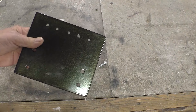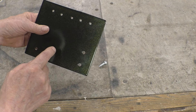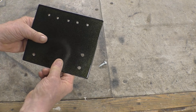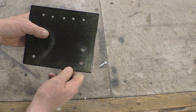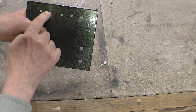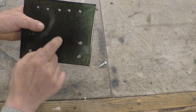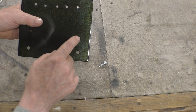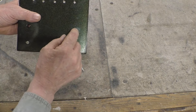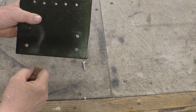We want to use this plate to ground the relays. Now we have to remember that powder coat is a plastic and it's an insulator, so we've got to provide a path for the ground for the relay to the chassis. We're going to have to grind a little of the powder away from the ground spots on the plate and grind some powder out from inside the holes — those are a tight fit — so that way we'll have good ground.